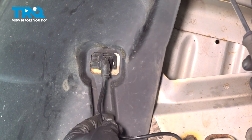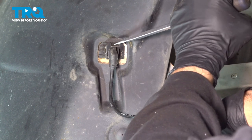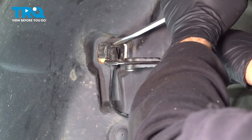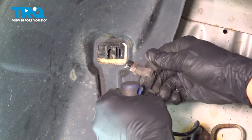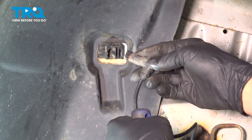I'm going to go ahead and disconnect the wire harness from the connector. I'm going to use our screwdriver to press this spring clip down and we're going to use our pliers here to gently grab this and wiggle it and pop this out. Normally it'll just pop right out, but we had some corrosion and dirt in there that was causing some resistance, so that's why we used our pliers.